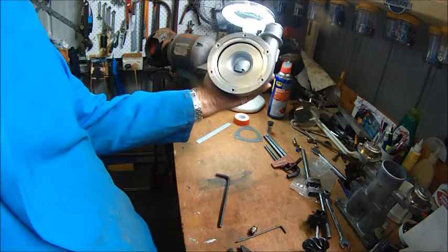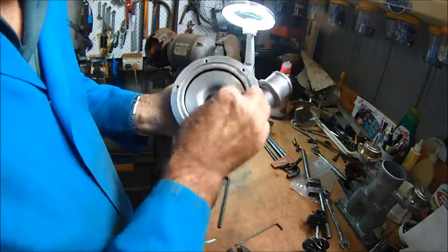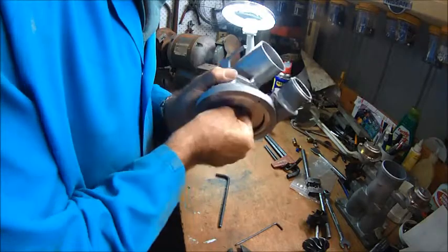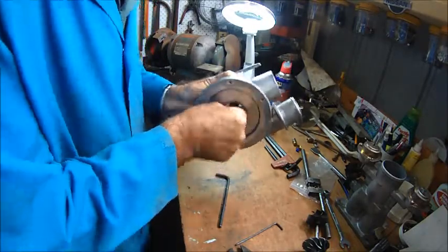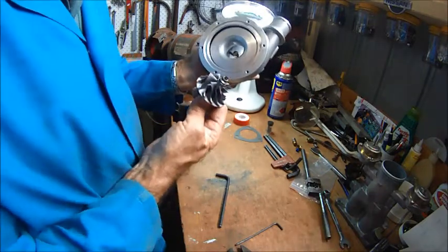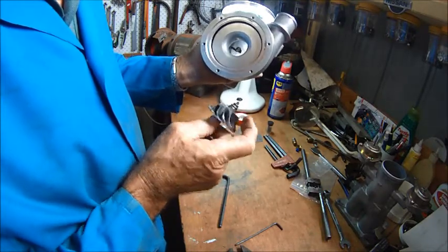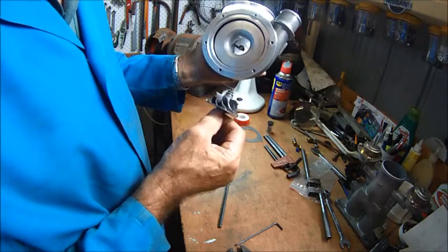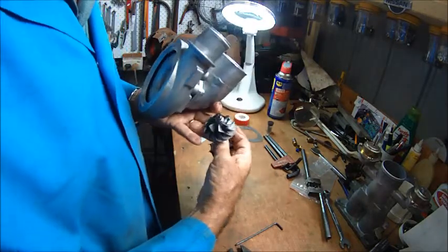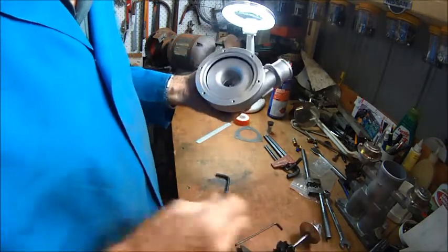As you can see, that tube is spot on in the centre. That will screw on, again staying right in the centre, and what will happen is that nozzle will be about 4 to 5mm out from the end of that thread, which means the water meth gets sprayed onto the centre — very little chance of it getting onto the outside and damaging the tips.